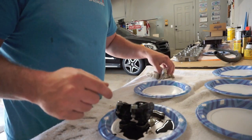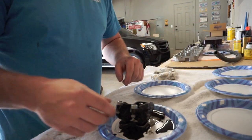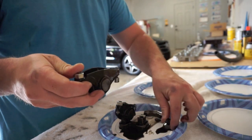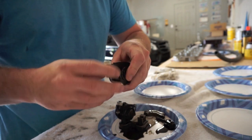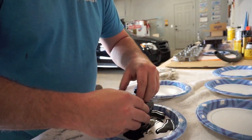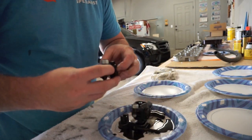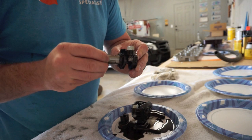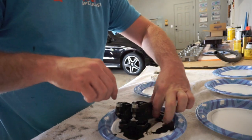I have the number six rocker and all the rockers out — got them labeled here: one through six. If you've got a higher-mileage truck that you haven't done this to before, I'd recommend taking out this bolt, sliding out the cam, and inspecting it to make sure there's no scoring or anything like that. My truck's pretty low mileage so I don't have any damage, but it's something to be aware of — you don't want to tear the truck apart again later for the same issue.